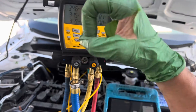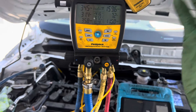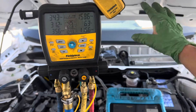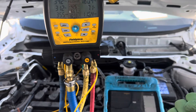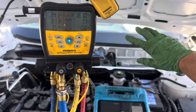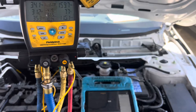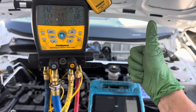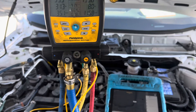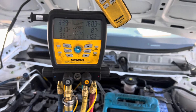Those guys who use the little whack-off cans — they only see the low gauge, it hit 30-31 PSI, whatever it is. They're not looking at the high side. They don't know what superheat or subcooling is. They take money from the customer, send the customer off, and the customer is happy because he has some cooling effect. He goes into a cool car and thinks you did a really good job. But you just screwed that customer because that compressor is running really, really hot and is going to have a shorter life.